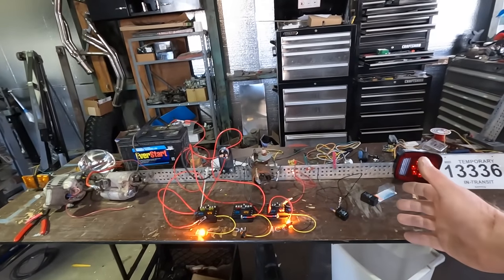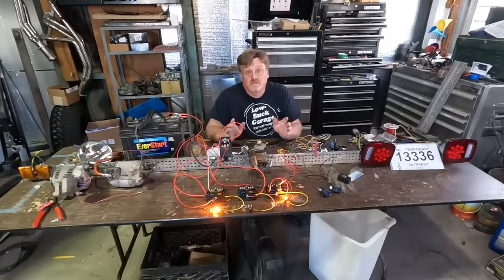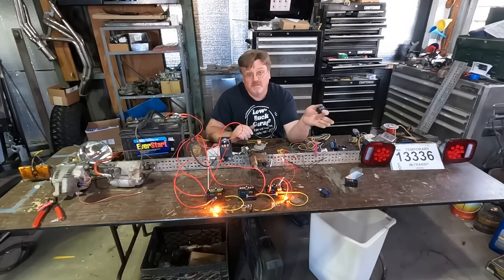I don't have a real good conclusion here. One thing that occurs to me is that the three-prong flasher with the extra ground maybe somehow makes the voltage more stable — I'm not really sure. There are probably other two-pronged ones that work better. If you do happen to know one that works, please leave a comment with a part number so anyone looking for that information can have it. But I know for sure this EP34 does work, so we're going to move forward.